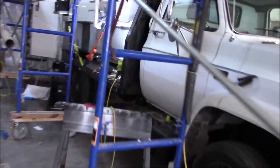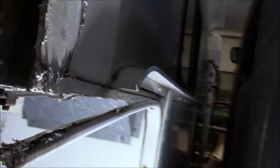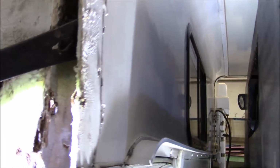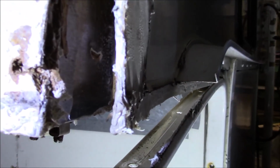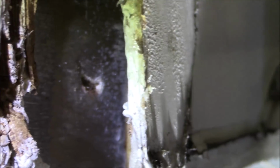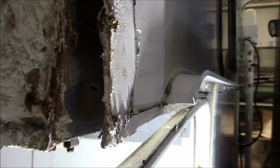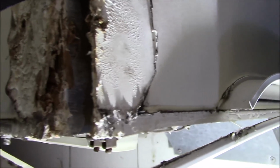I've got it open. And this is where some of the failures come in. When they framed this, they should have accommodated for a really good heavy steel plate at the bottom at least. But you should be able to, let me find that flashlight. Should be able to see that staple in there. See it right there? That's a staple. You can see how much it dimpled in. You're not going to get a staple through some heavy steel like that. It would just bend. You wouldn't be able to get it to ram in there.